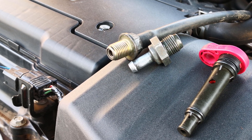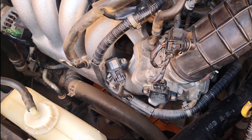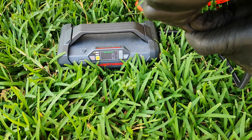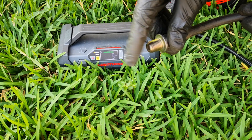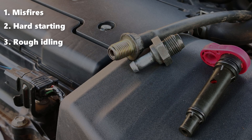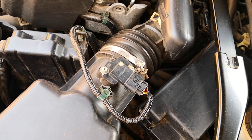The PCV system is made up of the PCV valve, PCV hose, and a vacuum source usually from the air intake or intake manifold. The function of this system is to vent blow-by gases from the combustion chamber back into the intake manifold to reduce emissions. On cars with turbos or superchargers it also prevents positive pressure in the intake manifold from going in reverse through the PCV valve and into the crankcase. A defective PCV system can cause drivability issues such as misfires, hard starting, rough idling, and can even give you codes for the MAF sensor when there's actually nothing wrong with the MAF sensor.